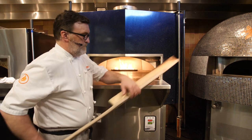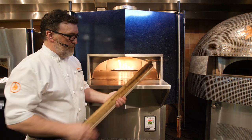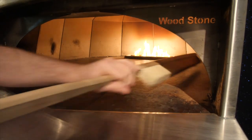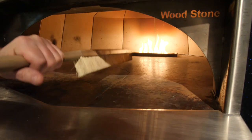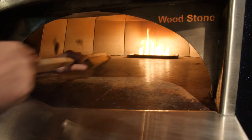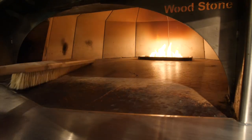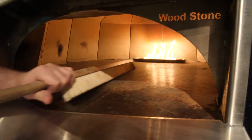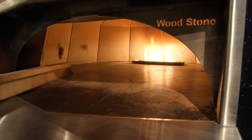Before you start cooking right on the hearth of the oven — your pizzas, your flatbreads — you really want to make sure you get it clean. We make a great natural fiber brush for this; it really gets the particles off the floor nicely. One thing you want to make sure you're always doing is sweeping away from that burner. You don't want to sweep toward the burner — you don't want to get debris down in that burner well or you will be going through igniters more frequently than you need to.